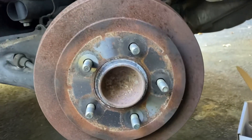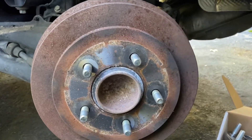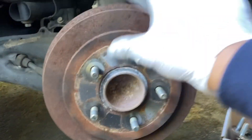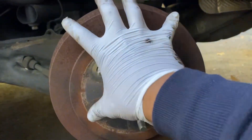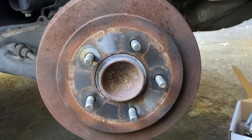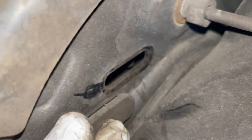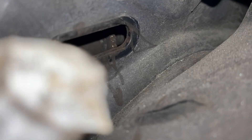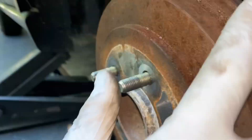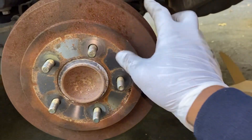I'm having a little bit of trouble removing the drum — you can see it's stuck in there. It's already broken free from here, but the shoes, the parking brake inside, is holding the shoes in there so it won't come off. You can go over here, turn on the light — if you look in the back right here, you have this rubber piece that you pry off. You can see that you can adjust the parking brake and the shoes right there to release the drums.